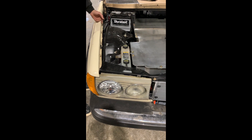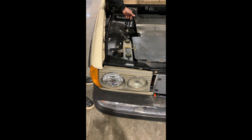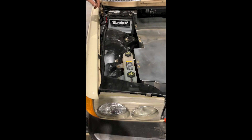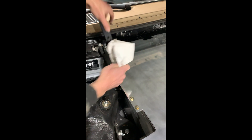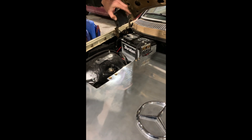The positive terminal was harvested from the Chevy Bolt as well, from the stock battery there. This is the stock Mercedes harness that normally plugs onto the starter — that's the spot where all the positives meet up on a 300D. And then this little guy here has inline fuses. This is actually from a Mercedes Sprinter van that I harvested from a junk one. So this is our master power providing power to the ignition circuit, to the power steering pump, and 12 volts all the time to our control box.